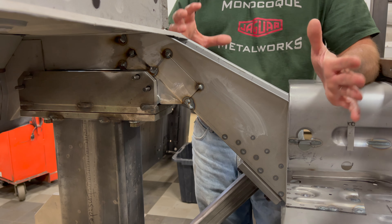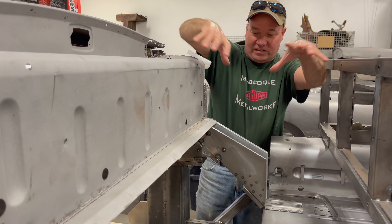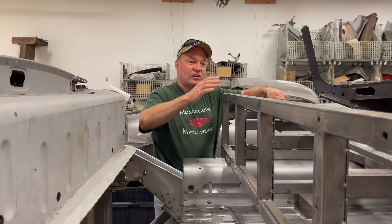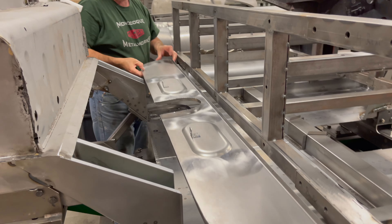We've been rebuilding the rear chassis legs. If you look in here, this entire front portion is our replacement piece, and up in here there's a little ear assembly that we've also replaced. We've got it all in our jigs — we had to have that to get everything in the right spot with various shims. All of this is in the perfect location, and we've also used other jigs to check the location of this wall. The tail jig sets in there so all of this is exactly where it needs to be.